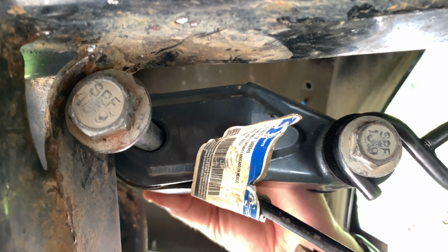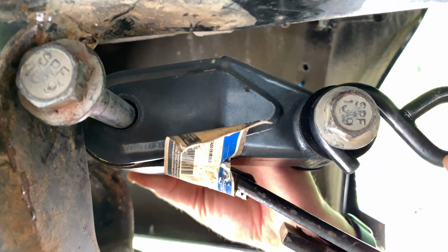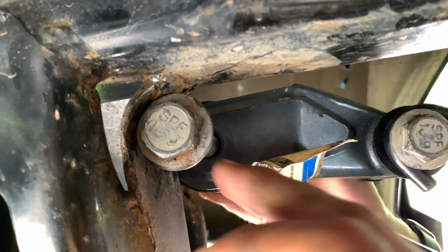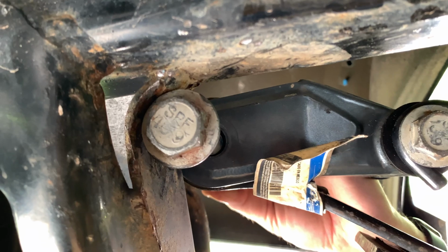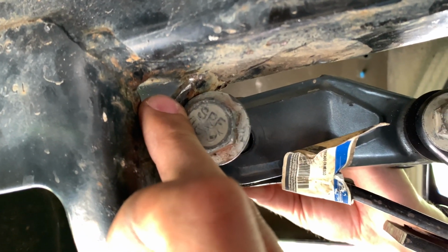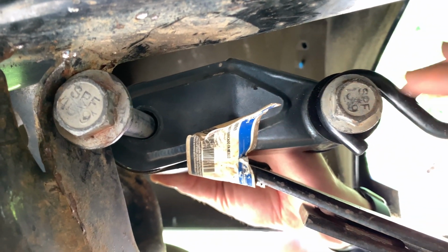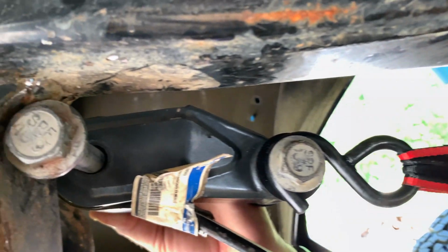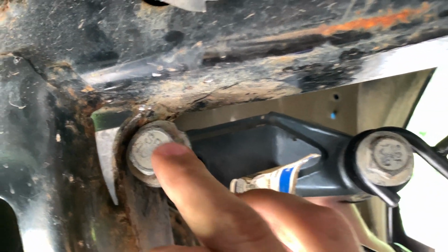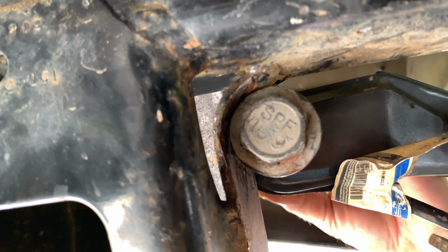All right, so obviously before you take off the old shackle with the tension, release the tension and then get it out the rest of the way. The bolt is strong enough that you can just hammer it out. And then once you're getting it in again, get it in as far as it'll go, then reattach it to the side, tighten the strap, get the shackle going in again, and then just start hammering away. It may scrape a little bit, but that's going to be fine. It's not going to damage the welds.